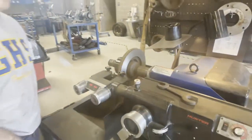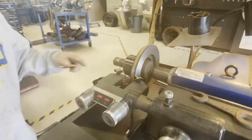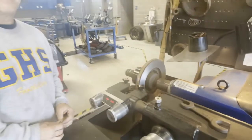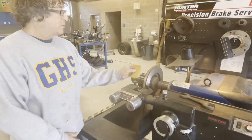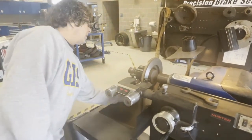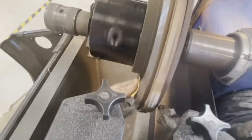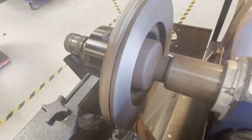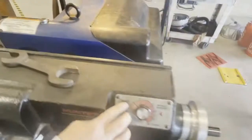Once it's cut all the way, shift this back to off to shut off the automatic feed. This has a circular pattern on it right now, and that tends to cause a squeaking issue. So before we take it off, we're going to take a little bit of emery cloth and rub it back and forth on here. That gives a non-directional finish, which should help avoid any potential squeaking. It only takes a little bit, and then we can shut this down.